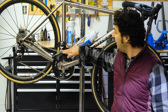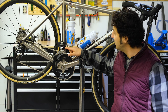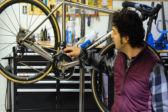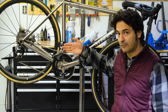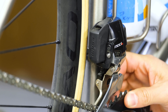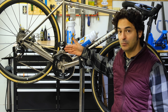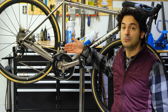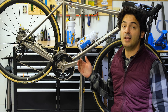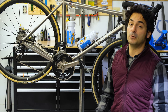The cage is connected to these arms that pivot — you can see the pivot points here. The cage itself moves in a pretty linear path from one chainring to another, and that's because these arms move in a parallelogram fashion. What that essentially means is as the cage moves inward or outward it's also moving up or down, keeping these plates parallel to the chain rings. That makes it a smoother, quicker shift with less effort from you.